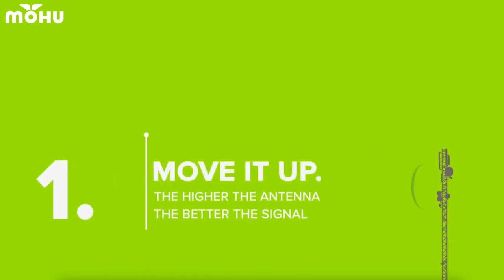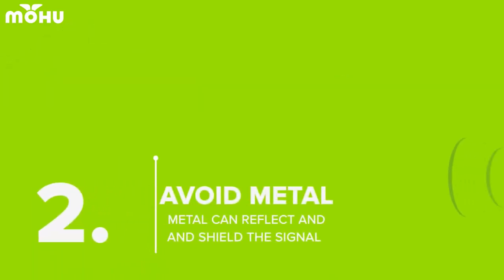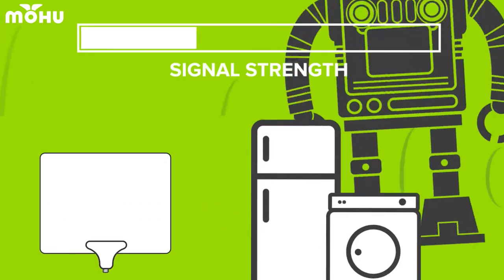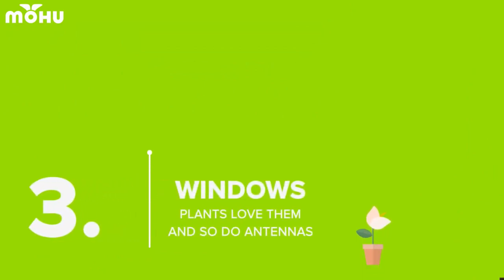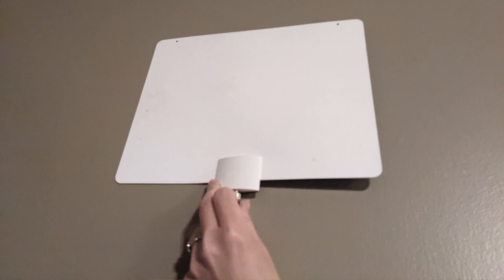What if you're not getting a good signal from behind your TV or in the place you'd most like to position your antenna, or you just want to see if a different location will allow you to receive more channels? Keep these placement tips in mind. First, position your antenna as high up as possible. Second, try to avoid putting your antenna near metal, as metal can block the broadcast signal — so avoid putting it near metal appliances like a washer, dryer, or refrigerator. Third, look for a window to put your antenna in. Broadcast signals can be stronger through windows than walls and furniture. In our case, our windows in our living room are too far away from our TV to be a feasible spot, and we don't have any metal to worry about, so we're going to try getting as high as possible to see if that improves the signal.